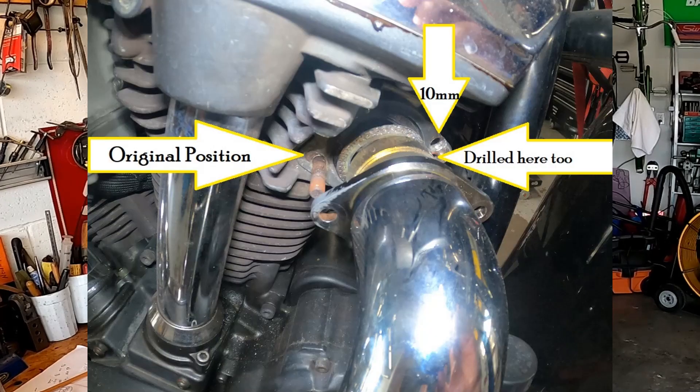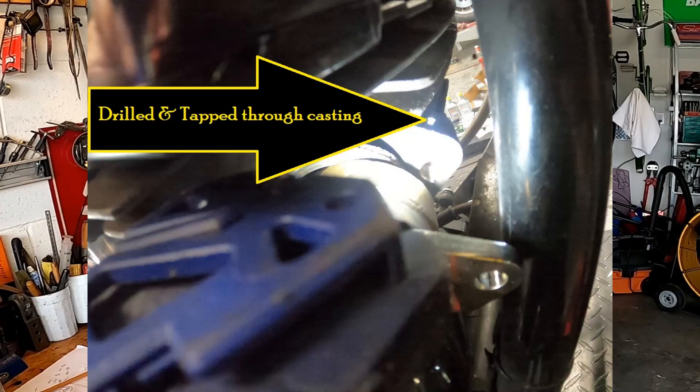The owner had gone to make the repairs himself, decided the stud positions weren't right, thought he needed to helicoil things — that wasn't the answer. He drilled out the head and made errors. He actually over-drilled a stud hole that wasn't even supposed to be there and popped a hole through the side of the casting. The previous owner had also filled in the original holes and re-drilled new ones that didn't align, leaving bent flanges — it turned into a nightmare.